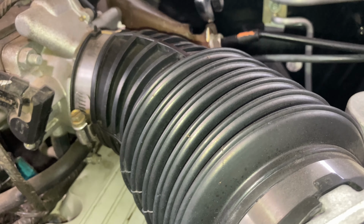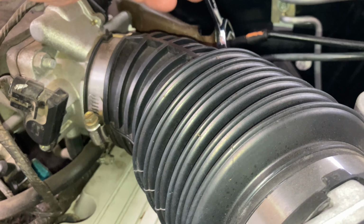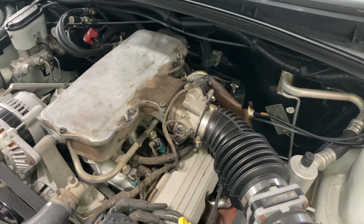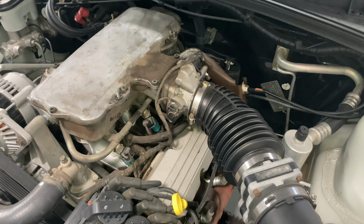That's enough anyway. I want to just go. Let me just tighten it up again. Right. Double-handed business going on. Yeah, see it? Look. See how it's loose, right? That's because this car is one of those cars I've talked about in videos previously. Back in the day, it's kind of probably half imperial, half metric, if that makes sense. So technically, it's probably a 9/16, and we don't really carry much in the way of imperial tools. So we're just going to keep using this 15 mil.